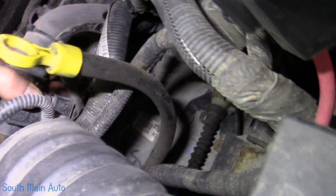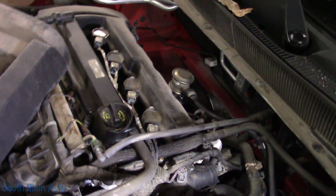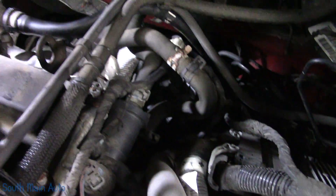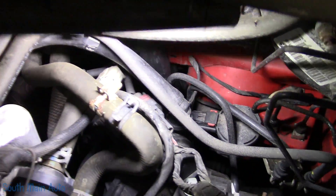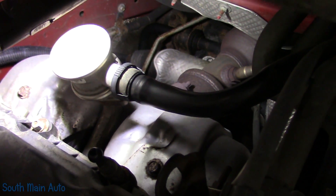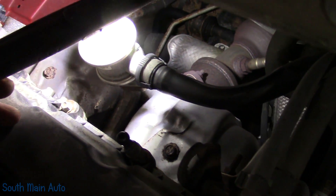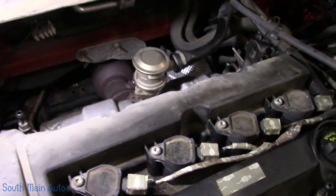It's a four-wire — I can't see it down there — but it has a mass air flow sensor, and that's how it tests its components to tell if it's flowing. The fresh air goes down through the pump, and then the air is pressurized out into this hose, which comes around to the compressed air side of the pump, then over to a straight-up mechanical check valve, and then hooks to the exhaust manifold to distribute air into the exhaust system to speed up the catalyst process.